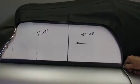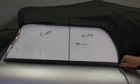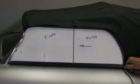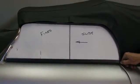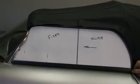Is this an improvement? Let's study it. First of all, there is increased visibility — you've gotten rid of the canvas surround, so you've probably increased your visibility by 25%, and on these cars visibility is everything. But let's look at the areas we've discussed that caused the problem. Number one, down here at the bottom near the windshield post, there is inescapable leakage. No matter how you seal that, it's going to be a problem. Even with a flap along the bottom like on the original side curtains, and a flap along the glass on the front — an improvement, yes — but unfortunately right up at the top, at the juncture of the three systems, you have a leak which won't go away.